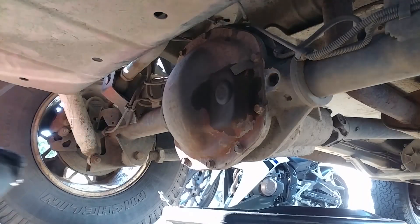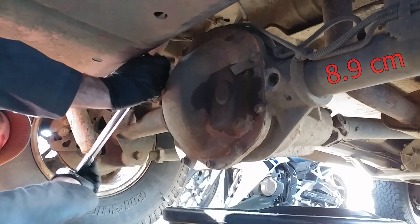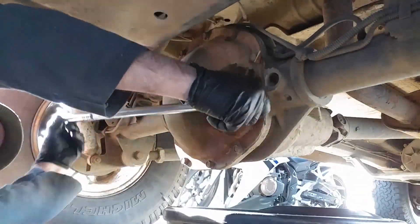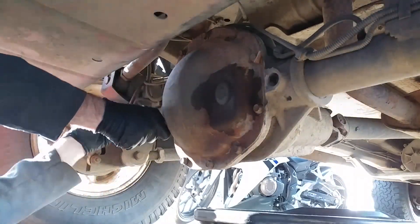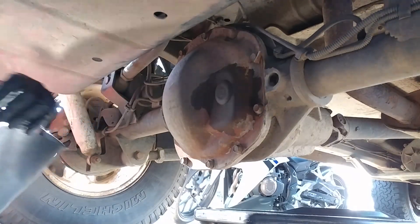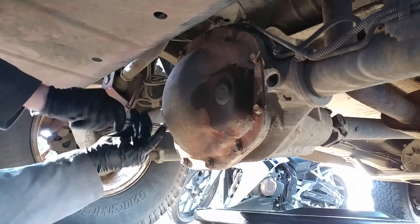To get started, you may need to jack up your vehicle a few inches and rest it on jack stands. My Jeep has a 3.5 inch lift, so I didn't have any clearance issues. First, I'll remove the bolts that secure the differential cover. I needed a breaker bar to break loose most of them. My rear skid plate leaves very little clearance for the upper bolts, but I was still able to reach them with a standard length socket. I used a socket extension just to make removing most of the bolts a little bit easier.